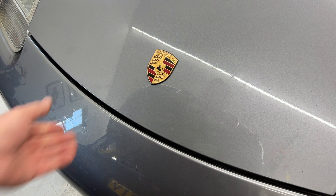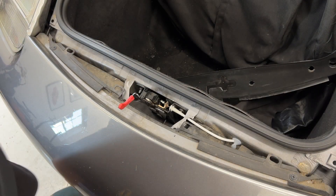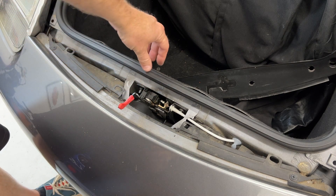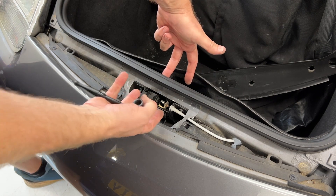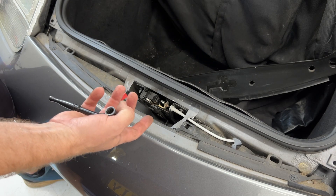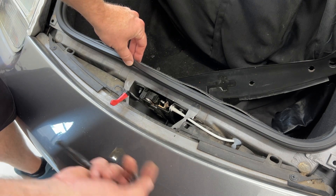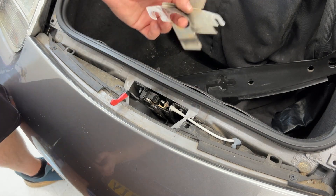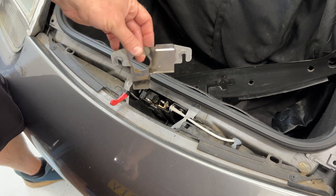And the release works. That was a cheap, easy fix. What I did is I loosened the two 10 millimeters that are back here behind it. I just pulled this mechanism up a little bit higher so that it would be closer to the latch that comes down into it, and it locked just fine. So I've got to loosen those bolts up one more time, stick this piece back down there, tighten them up, and we should be good to go.